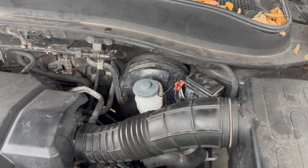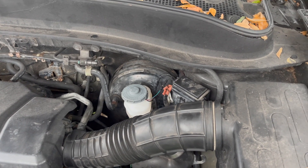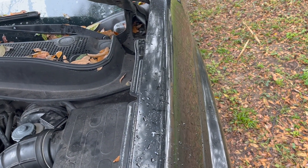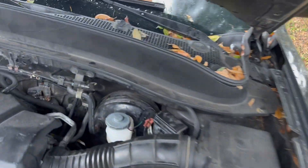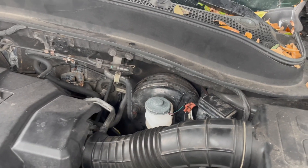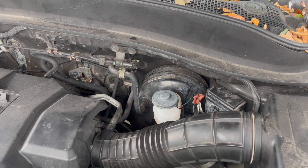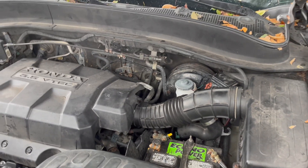Little update — I drove this truck for about two hours. Even though the truck is braking fine with no issues, I can definitely tell that there is air in the system. I tried to get air out through the brake calipers but it didn't really work. I might have to do it also through the master cylinder. I'll leave it at that, and in a bit I'll release another video showing how to get air out using a power bleeder and maybe some other tools. Thanks for watching, see you next time.